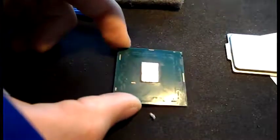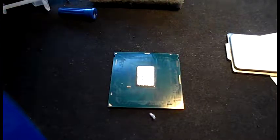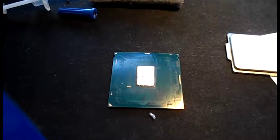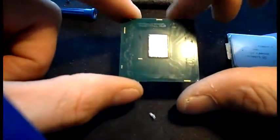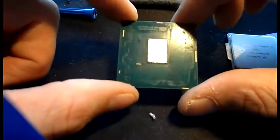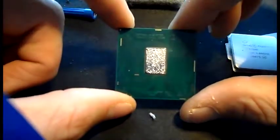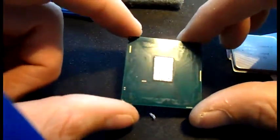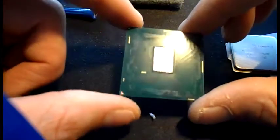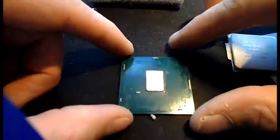If you've got some silicone, by all means silicone it back up - it's going to make it a lot easier if you ever swap motherboards or if you're going to be bench testing a lot. We want to be delivering decent results with our reviews, and to do that we need to make sure all our cores are within a reasonable temperature of each other - otherwise you're going to have one core at 83 degrees while the rest of the chip is at 69, and it's not going to look good on the product.